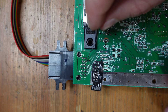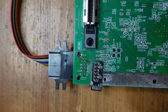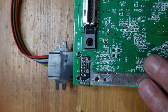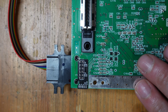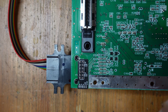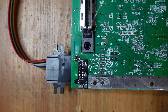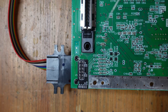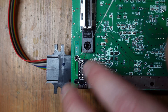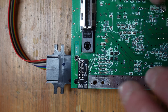With this older revision of the motherboard, the components for C-Sync are actually gone — they would have been here but they've been removed. So I'm going to add this little board right here called the N64 Buddy Board. This is designed by Fraggle Tech — you can find him on Twitter and I have links in the description for his website and GitHub page. He's made a variety of really nice useful boards like this one that make installation of mods much easier and convenient. This little board fits right onto the multi-out, so instead of soldering my RGB, Sync, and ground wires directly to these tiny little pins, this breakout board solders directly to the multi-out and provides much larger pads on the side, which makes the whole process easier and more accessible.